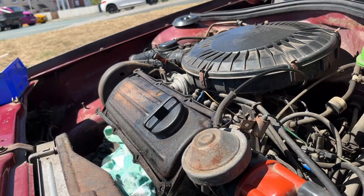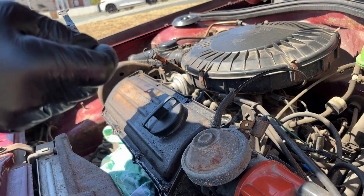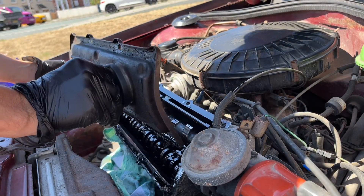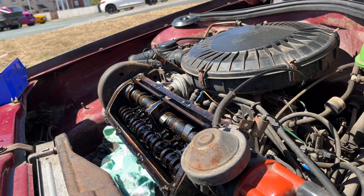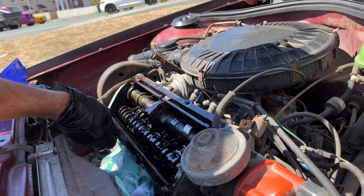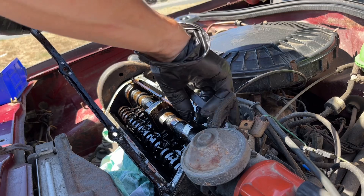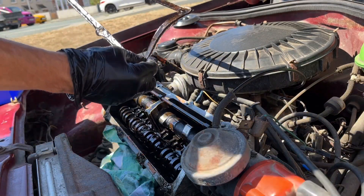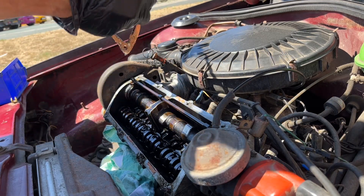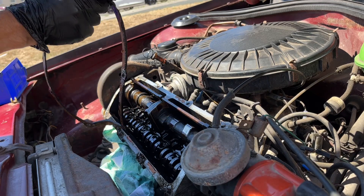Let's fix it. After the eight bolts are undone and two metal brackets, let's take a goosey. A little bit wet right here. Usually get tightened down too much and the gasket squeezes, but as you can see here how thin it is - that's where it's leaking. It was just that one corner, and see how it was pinched.